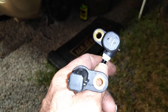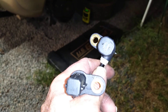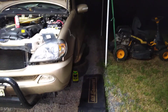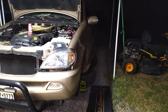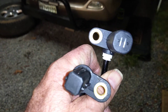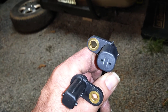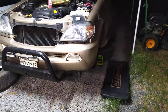I had mistakenly bought three — I didn't pay attention to the chassis number splits — and I got the wrong ones. I got late ones and I need early ones. My ML has sat and I wondered what the beeping lights, limp mode, and problems were all about. Your chassis split number — let me see if I can remember this — it's A371935. Anything after that is a late sensor, like the one with the plastic end on the left. The one on the right is for earlier chassis MLs, anything before chassis number A371935.